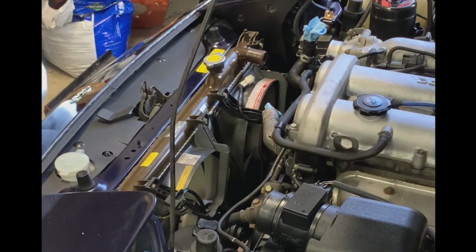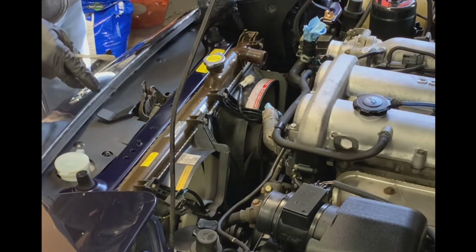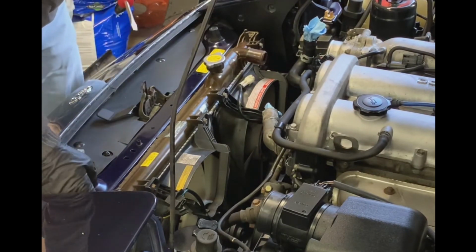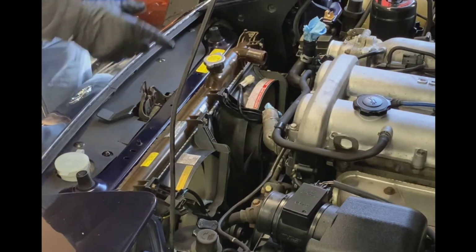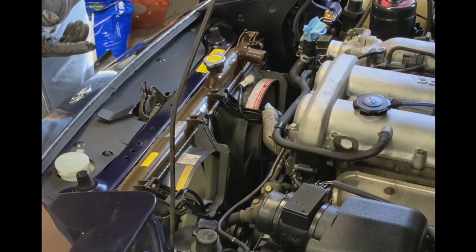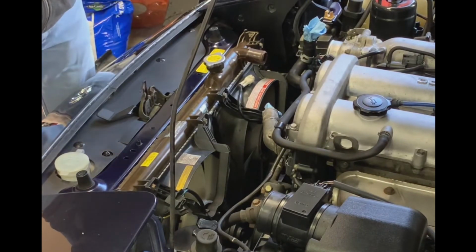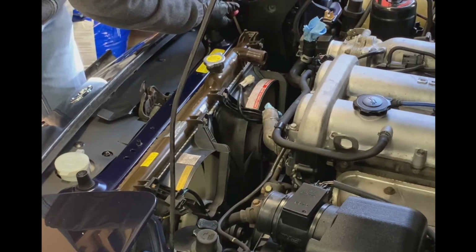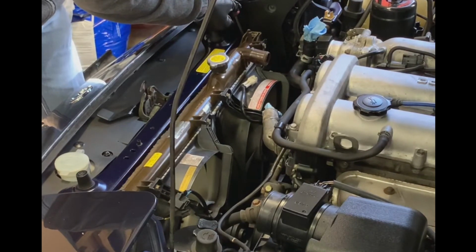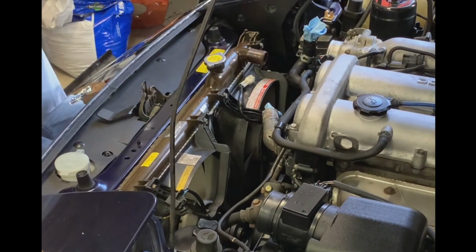Figured out what my problem was. On either side where those 12mm bolts went, there's an anti-vibration rubber pad. What's happened over the years is that, kind of like all the other rubbery things on here, it glued itself down. So, using just a flathead screwdriver, it's a simple matter of wedging between the bracket on the car and the bracket on the radiator, lift, and it makes a nice little pop. And now we are liberated on that part.